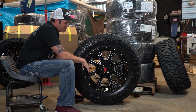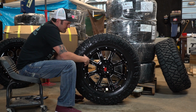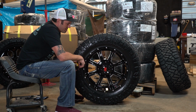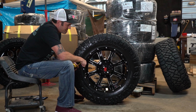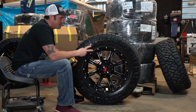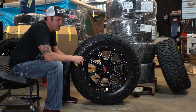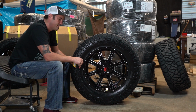They kept it right in there. On a 10 wide, for a deep lip wheel you pretty much wanna be around 4 inches or greater. Anything around there's gonna give you that lip wheel look, and that's what they've accomplished here. So that one's gonna look good. Like I said, it's got a covered cap, so no spike lug nuts for this guy. It comes in the two finishes, and then 4 different sizes, 17x9, 18x9, 20x9, 20x10.